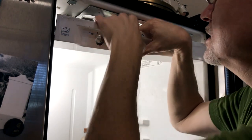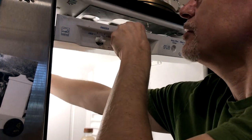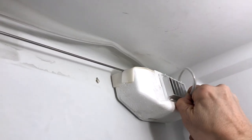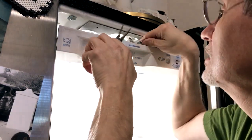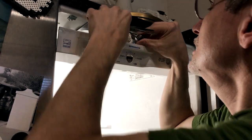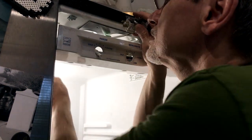I was able to remove those quarter-inch screws and now I'll go ahead — this is the thermostat. All I need to do is unravel the end of the thermostat, pull it out, and take this out. Then unloop this and pull it out through here, because as you can see it's locked in there and I don't have the tools or skill set to deal with that rod. Here, once again I'm going to thank Steve because he suggested using needle-nose pliers to disconnect this. At this point you're probably saying let's just go watch Steve's video — probably a good idea, though Steve's working in a completely sterile environment, unlike anything you'd encounter in the field.